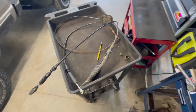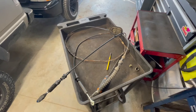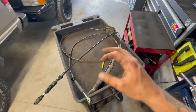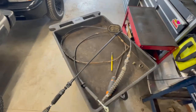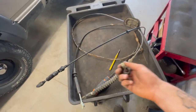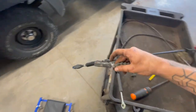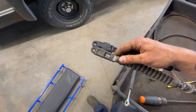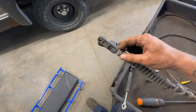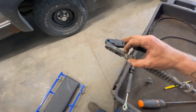It's almost time to do everything in reverse order and reinstall, which I don't usually film because it's pretty much reverse order from taking it apart. Reroute the cable - it's almost easier because you're just popping stuff in place instead of actually removing. So I made the cable adjustment - I figured out how to do it. I referenced the old mark on how it was adjusted, took the new one, inserted the locking tab at a specific location, and now they're adjusted to the same length so the transmission will go into gear exactly how it did before.